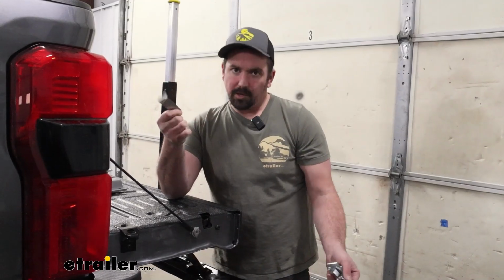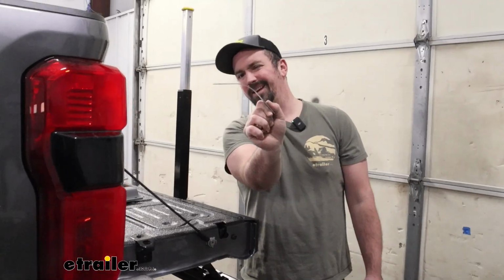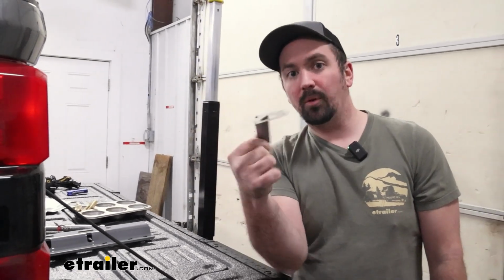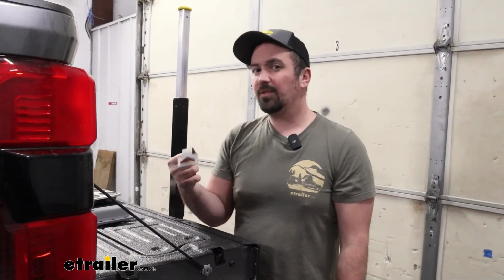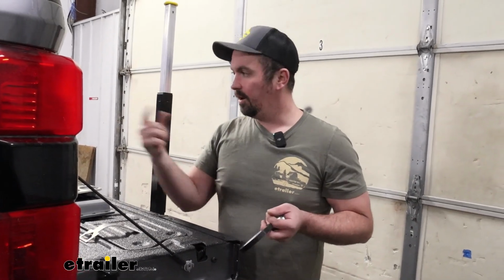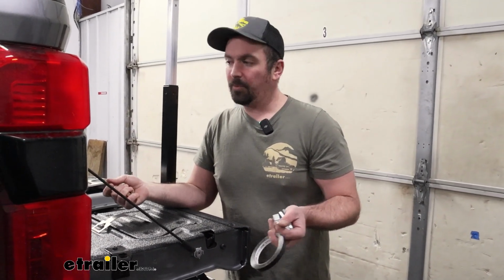Now, it isn't terribly difficult. It's just kind of unique. It's hard to see. So as far as the bend, I kind of ended up with something like this, and I just pried it to where it was straight up to where that bolt can thread. I had Beth using a 3/4 inch socket and just rotate that around until it catches on both sides. You don't have to crank it down, just make sure that it's threaded on there properly.